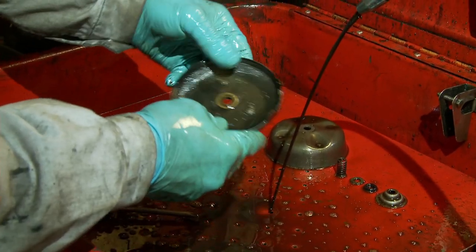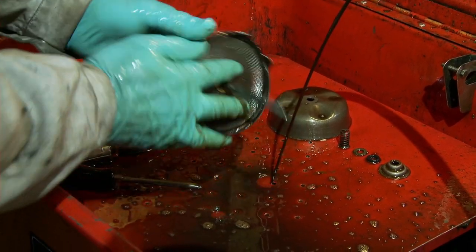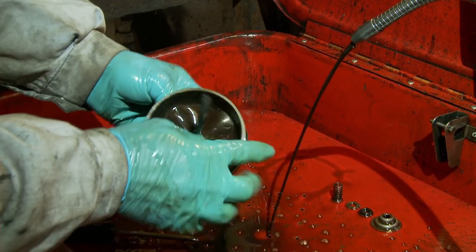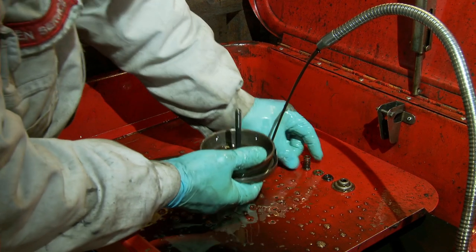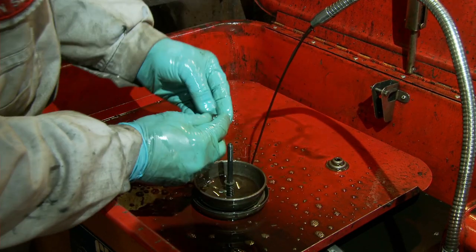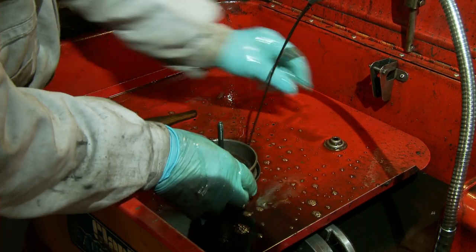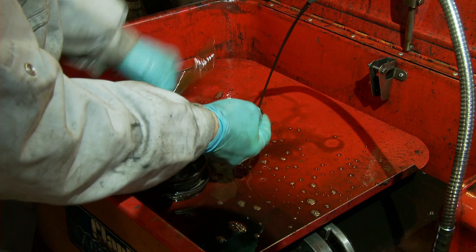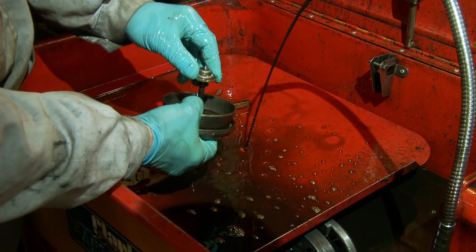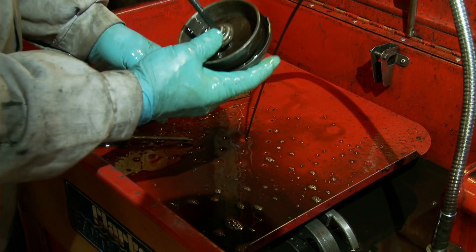Put the O-ring on the gauze, fit that into the lower cover, slip the bolt through. I haven't bothered changing the washer, but you can if you like — you could anneal it as well, like I demonstrated earlier. Then the spring, washer, the smaller O-ring which needs to go over the thread, and then the cap. This cap, perhaps slightly counter-intuitively, goes down the way, and the oil filter, when we fit it, sits on the ridge on this cup. That's the assembly — ready to go back in the car.